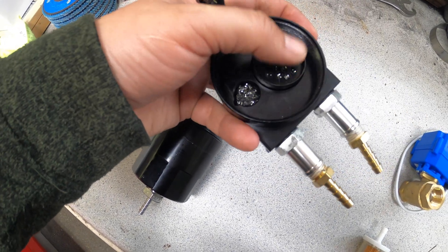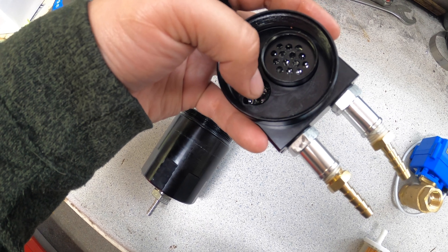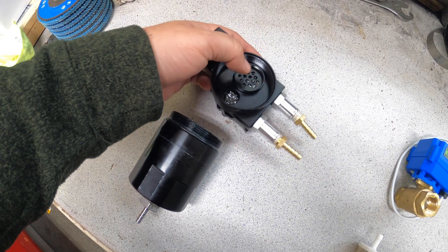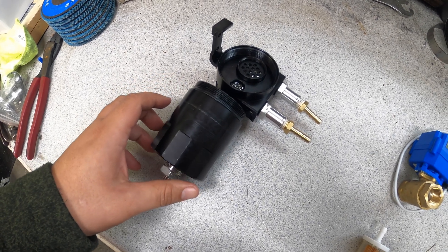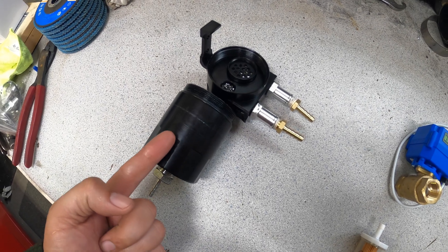During on, it'll essentially come in and come out. Since it's going to a ported vacuum on the throttle body, it'll help evacuate the vapors from the fuel tank as well as help purge the carbon. When the tank is actually under vacuum and there's no more vapors to exhaust, fresh air will come in through the charcoal and help purge it.